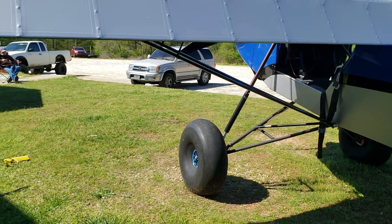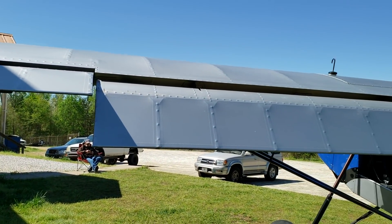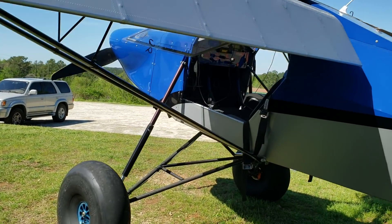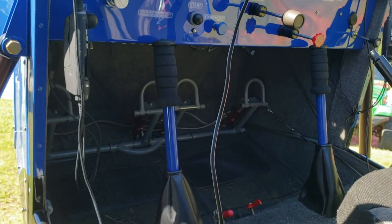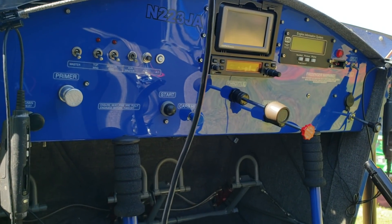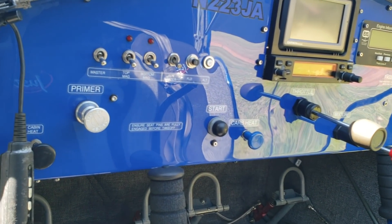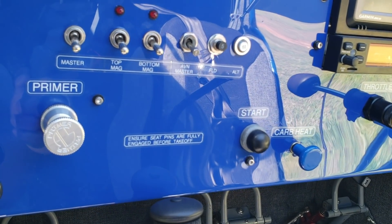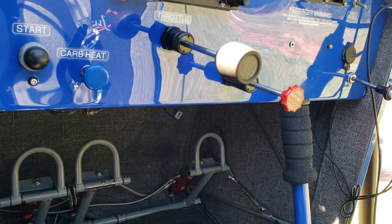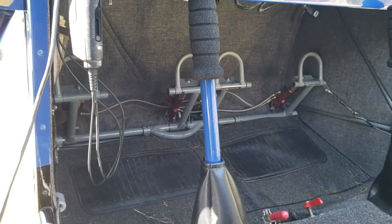I also love the paint and color scheme — it's silver or gray and blue with some dark highlights. Really neat. When you think of STOL airplanes, just think of airplanes you can fly right out of your backyard, and that's what this is. Now let's go look at the panel and check out the interior. Looking in here, this is the most minimalistic panel I've ever seen — maybe four switches, two circuit breakers, a throttle and a mixture. Since there's no prop lever, this is a fixed pitch prop. You've got rudder pedals and a stick for controls.